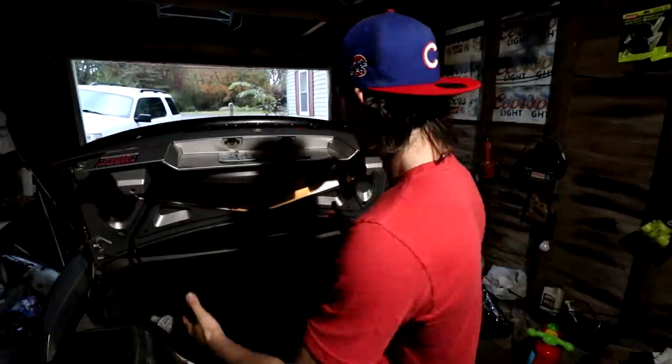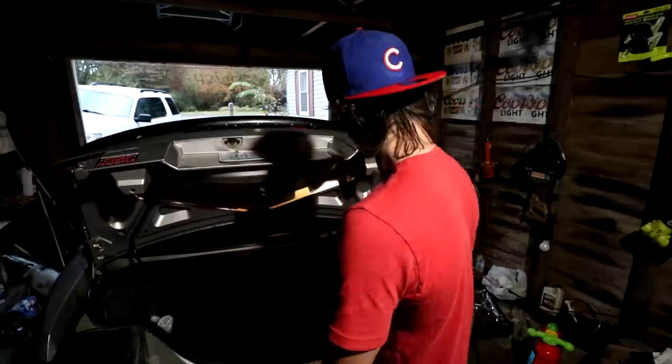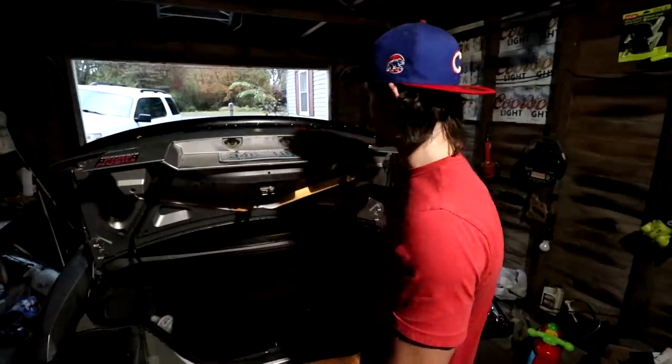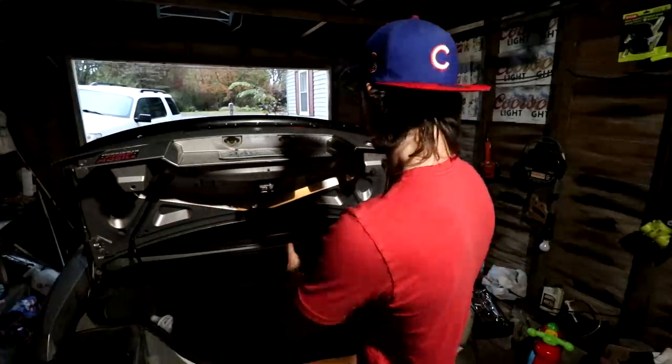One thing I did notice is I had the trunk open and the doors open for a while. So all these lights were just on and it made my battery a little more weak, drained some power out of it. When I was trying to tune the amp, I noticed that it would kick into safety mode. And I think that was because the amp wasn't getting enough power because the alternator needed to spin, give the battery some more juice. Correct me if I'm wrong. Start it up and let the alternator spin, and then after I did that, leaving it running, it wasn't cutting into protection mode anymore. All right, let me turn on the song.